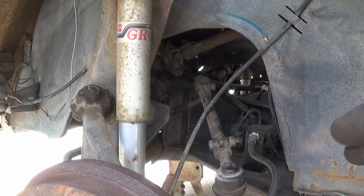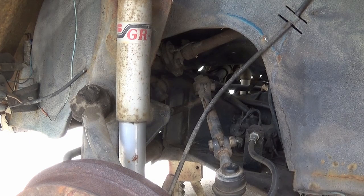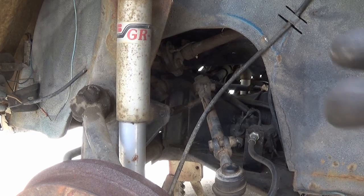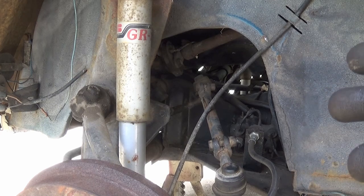And that may be because the tie rod ends where that goes into the arm, the tapered part, is a little bit bigger on the ball joint than the early link pins. Bigger car, bigger engine, more strength. Those are the subtle things that Volkswagen always did. They didn't just come out with another model of car. They improved the car that they had. The beams aren't interchangeable. You'd have to modify the head in order to get a link pin to fit, and there's probably no reason why you want to.